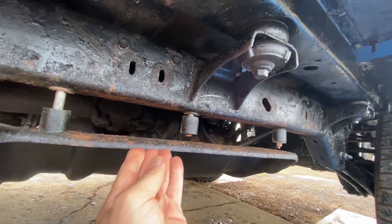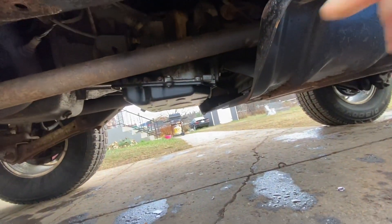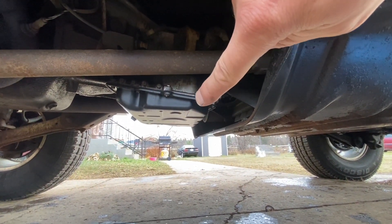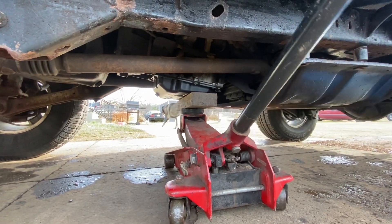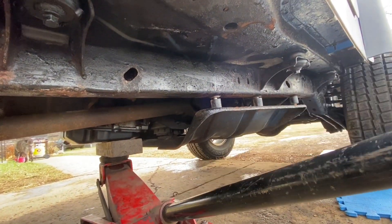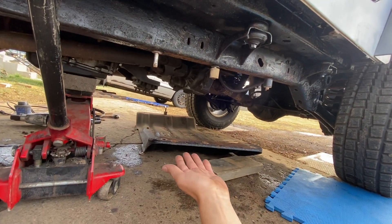I cut all three heads off and the plate is off. Now I need to unbolt the other side, but first you want to get a jack and a board to distribute the weight to support the transmission so it doesn't sag down. I got the jack under it - just a few pumps to get it to where it was - then let's unbolt the rest.